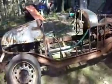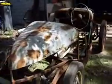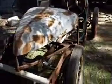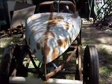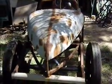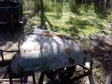It's a 1946 Morris Z chassis, which I'm making into a little boat tail coupe. No, roadster more than a coupe, I suppose. It's not at all standard. In fact, the only thing that's really Morris Z about it is the chassis. The back here is made out of two sections from a Morris Minor bonnet, which gives it a nice shape. I've got a little bit of distortion in the top, welding it together, but nothing that a bit of bashing and filling won't fix.